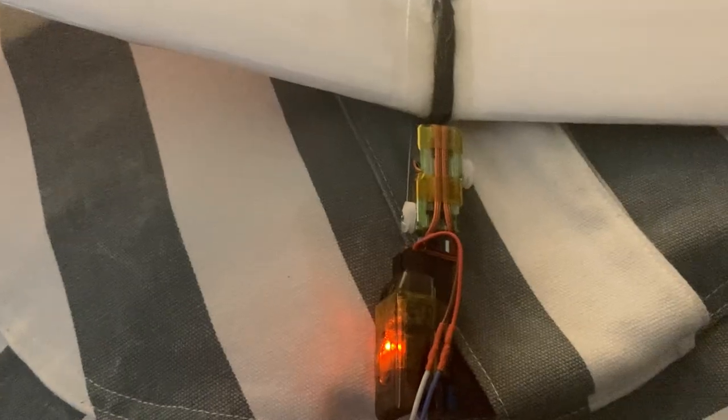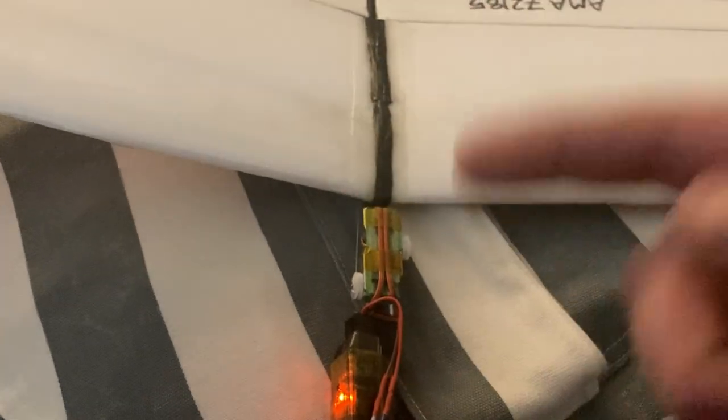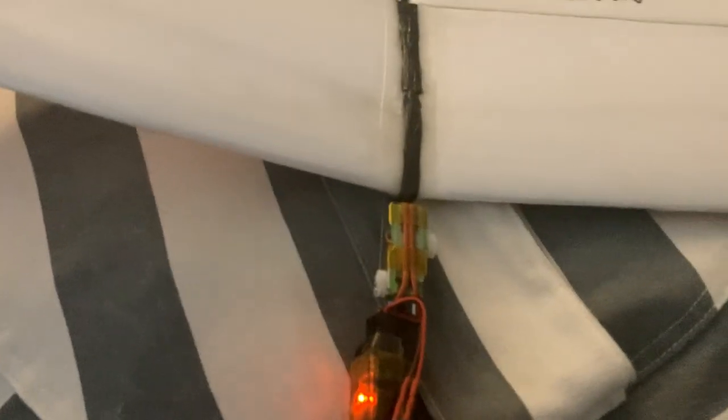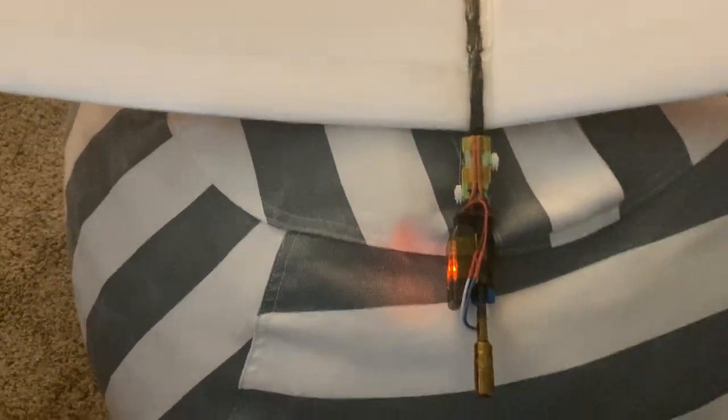But under the hood, pretty simple. I went high end this time, though. Those are KST X06s. Now they're taped up as per the convention. I'm not going to glue a $40 servo directly to any shaft ever. So that's green frog tape over that, which is a really high end version of some painter's tape that works well, and wrapped in thread like is the convention. I mean, you can Google that and find it. And then glued to the shaft. So if something fails or if I'm getting rid of this thing and it breaks, I can literally just slice the tape and pull the servo right back off.